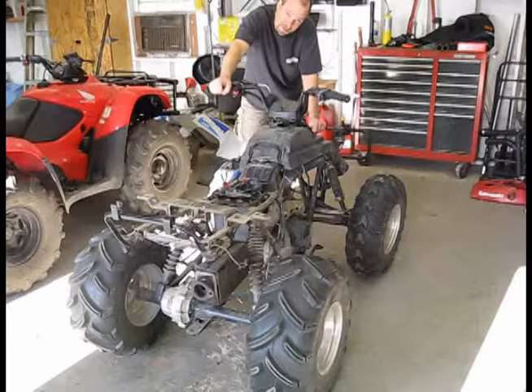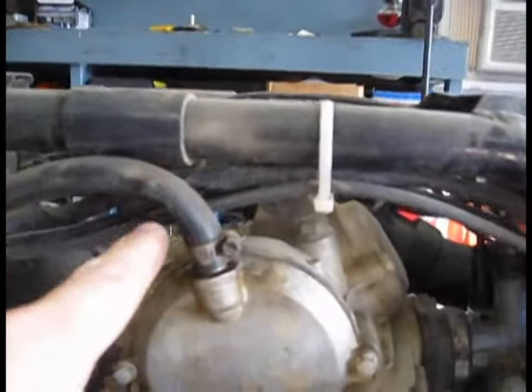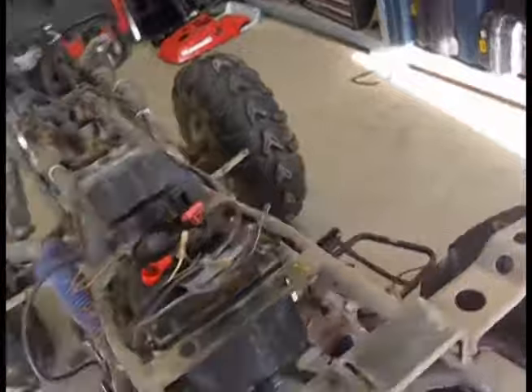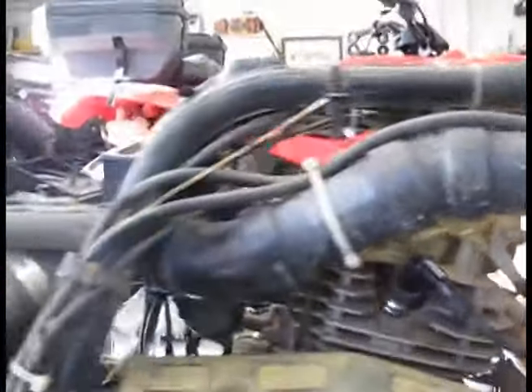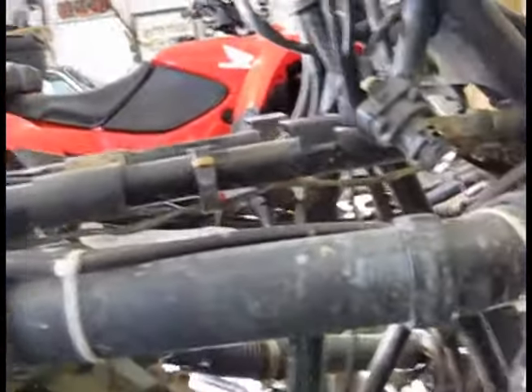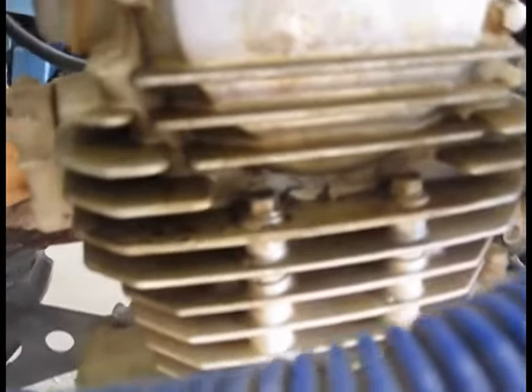The front plastic is off. So we're going to make a little change here. Originally the line actually went that way — the other side teed off and went down and up. I'm going to kind of do that general idea. I'm not exactly sure how I'm going to do it until I start routing the pipe, but I think I'm going to bring it over to this side, run it back in here and give it a downhill run so the crap that wants to go up the pipe runs down into a reservoir, then run another vent line from the reservoir back up again. I'm starting to wonder if you've got to do it — I've got a little fresh oil right here where I think maybe the crankcase pressure is building up a little bit too much and causing it to leak, because I haven't had this leak before.